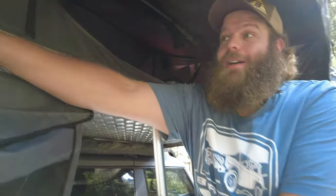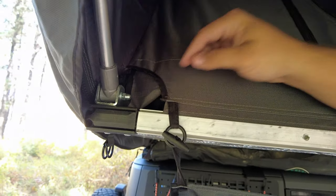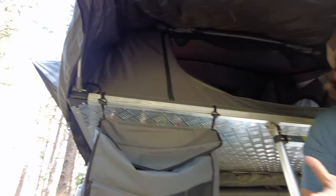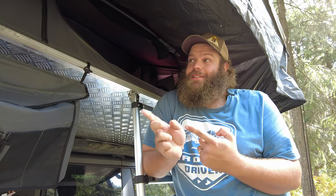Out of anything we've actually had go wrong with the tent, I can only report one thing — and it's probably my fault for not tightening it enough. Watch the pivot point that holds this bar — the nut can come loose from road vibrations, and one time when we went to set up the tent it was gone. I just looped a zip tie through it and problem solved for the night. Periodically go through and tighten everything up — that's where I could see failure points occurring as things get loose over time.